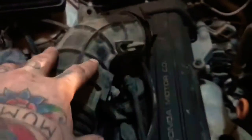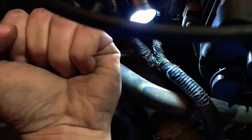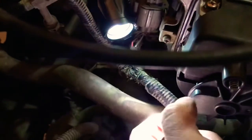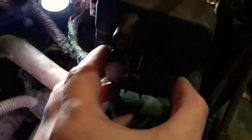You will have one connector here — just a little hose clamp. Just squeeze it, slide it out, and you're good to go. I suggest putting force against the screw with the screwdriver — pushing in — and then twist as hard as you can with one single twist to get it loose. It will basically snap free and you will be able to back it out. I have already got it out, so I'm going to go ahead and slide this rotor off. It is as easy as that.